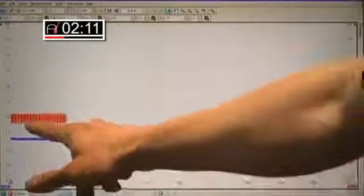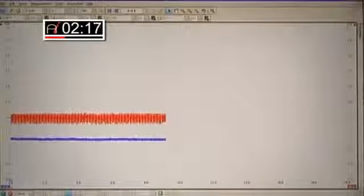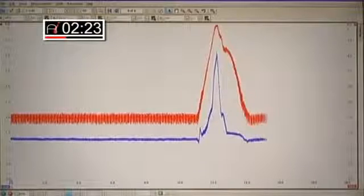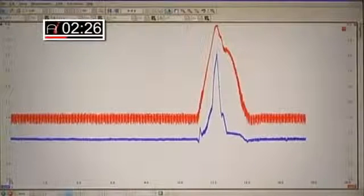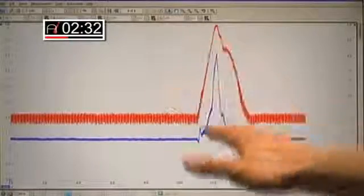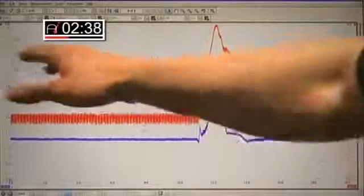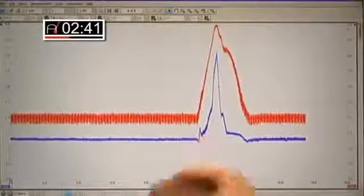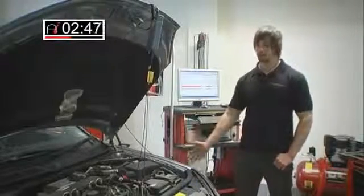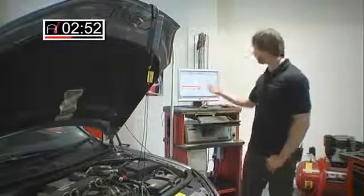So the red channel is the air flow meter, and the blue is the rail pressure sensor. I'll get James to give it full throttle. So if you can cut — I've got a very clean signal, a very close relationship between the air flow and the rail pressure sensor. I've got four volts on the rail pressure sensor, which is pretty much at its maximum, likewise with the air flow meter. Now what I'm going to do is produce a problem on the car and show you how we can detect this using the oscilloscope.